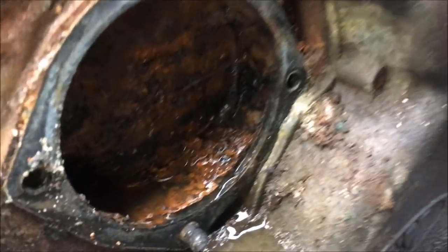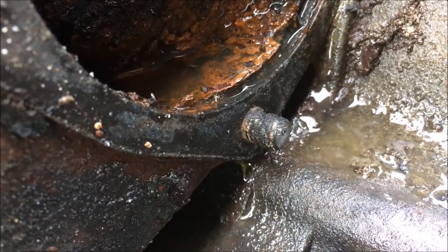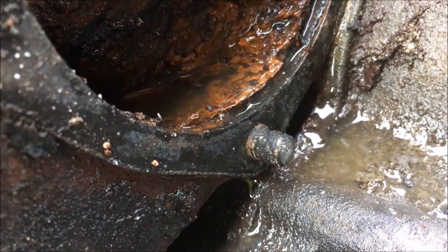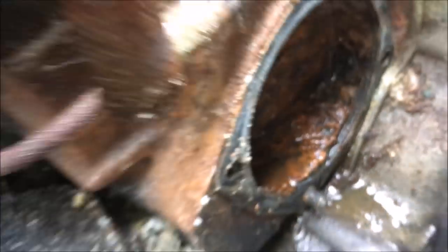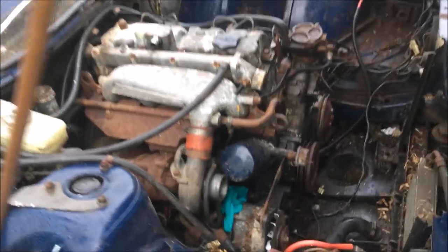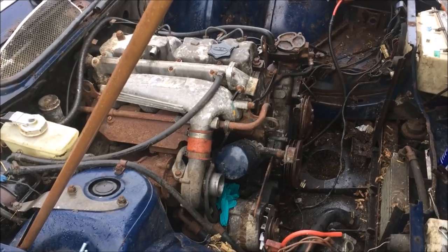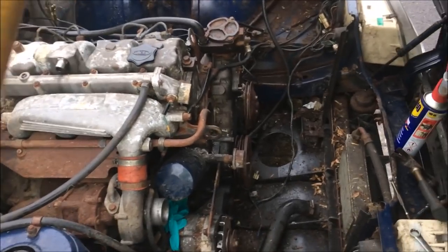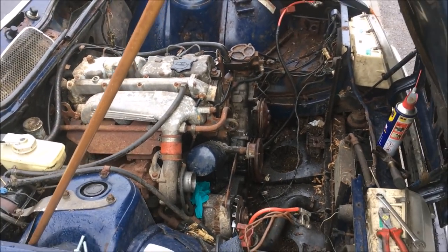In terms of where it bolts, there's a lot of crap in there that I'm going to have to clean out. And really annoyingly, one of the bolts for the water pump sheared off at the head, so I'm going to have to get that stud out somehow — probably clean it up, leave it to soak with WD-40 and then a bit of heat. First I'll try mole grips; after that I'll bring in my MIG welder and try to weld a nut to the top, because there's quite a lot exposed. Then if that shears off I'll have to drill and tap it, which yeah, that's a ball-ache, but hopefully it won't come to that. Access is quite good though, so if I take the bonnet off I should be able to drill a nice straight hole. Fingers crossed it comes out with the mole grips and a bit of heat.